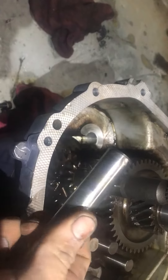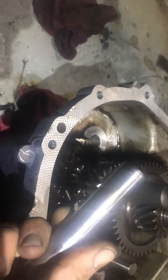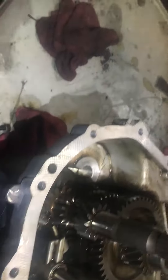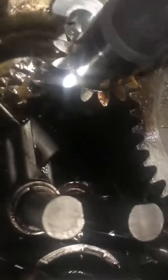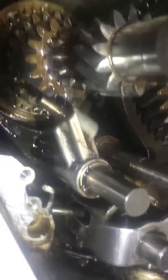So we're taking some measurements of this shaft to make sure it is within spec still — it's probably going to get replaced along with that bushing. And if you take a look inside, how nasty and dirty this thing is. The oil has probably never been changed. The bearing race is there. As I change it out, you can see all the shift rails and shift forks are going to be coming out, and we're checking out all the synchros and everything else inside here.